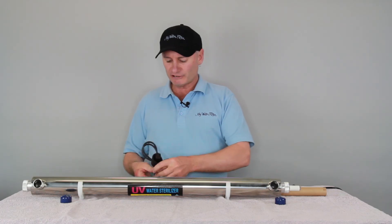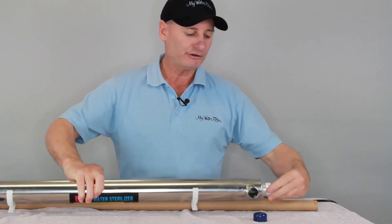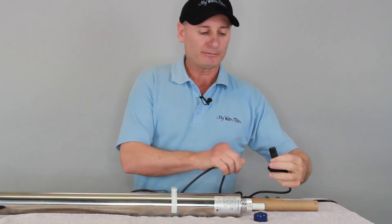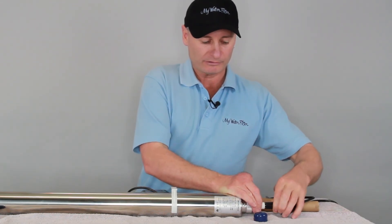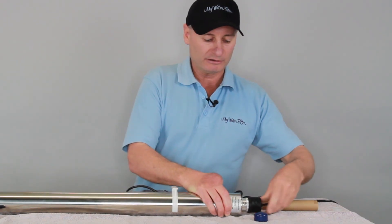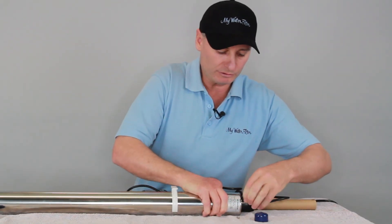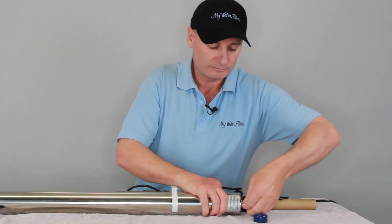So we're going to undo this end here and give you a look. As you can see, we've got a little earth wire, and that's going to fit onto our little earth wire clip up there. So here's our cord and here's our pins — they're a bit offset, so you've just got to make sure they plug in onto the right ones. That's on, and then we just gently push it in and we've got this big black cover. That black cover is going to go over the end to seal it up, then we take off the little nut, put that one on, push it in a bit more — and that's back on. Tighten it up.